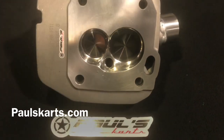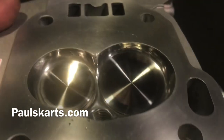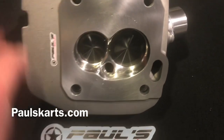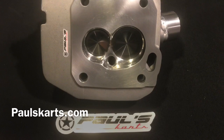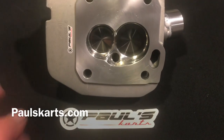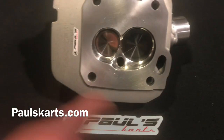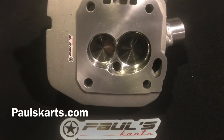But a head like this really performs well on methanol with that raised compression ratio. Nice piece — it's got the dual hurricane pattern, the flow pattern if you watched it with the smoke. It's a really nice head, and that dual hurricane really helps to amplify that fifth cycle, or that scavenging event that happens.